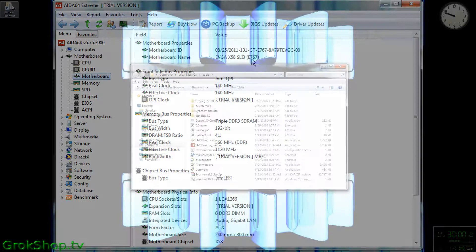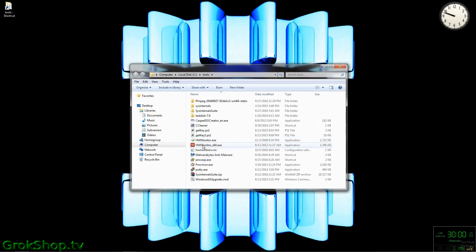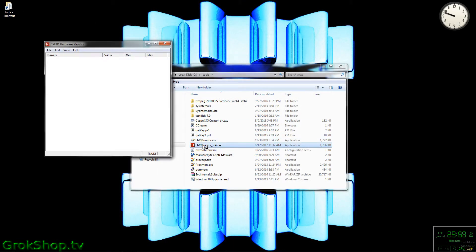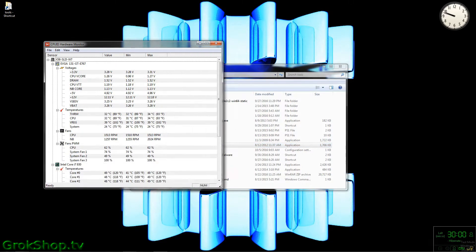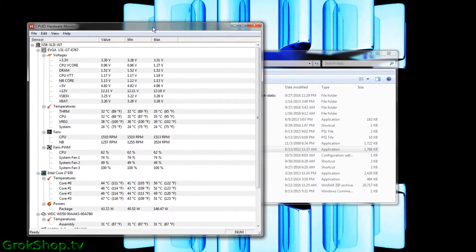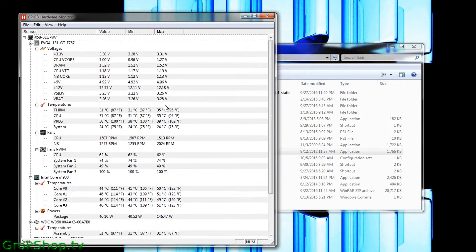It's a good idea to get a handle on your CPU temps. I recommend Hardware Monitor for that — I'll put a link in the description. Take a look at your temps on your old CPU before the upgrade, and then check your new CPU after it's installed. You want to be at or near those temperatures or lower if possible. It looks like here we have about 30-31 degrees for the motherboard CPU temp and core temps running in the low to mid 40s range.